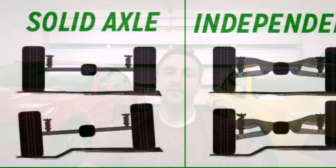Moving on to the solid rear axle — if you look at the two you'll know why they call this a solid rear and this an independent rear. With independent rear suspension, each of the arms are independently operated; you have suspension on each side allowing each side to lift and raise. On a solid rear axle, being that it's basically one solid piece, the whole thing will bounce around but stay straight, and that's why they also call it a straight axle.